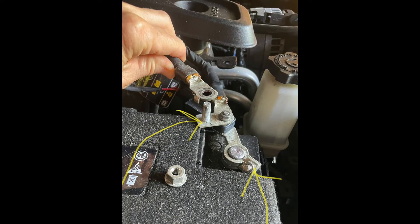With our RV you actually have to also remove a fuse. However, through our research I have found nothing confirming there's any kind of fuse that you have to remove for the auxiliary battery in a Jeep Wrangler. If someone knows of that, please post in the reply. But as of now we are storing the Jeep Wrangler by just removing these two — both negative leads — and keeping them off the terminals while in storage. Hope this helped. Thank you.